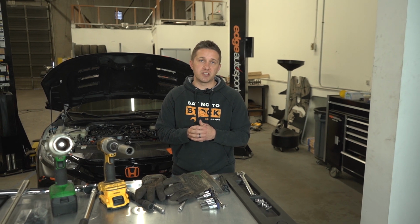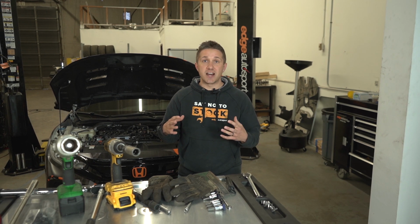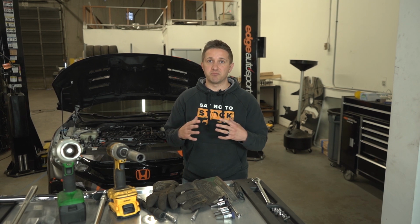So we hopped in the car and we started it, and unfortunately with the twin disc, I think we're going to experience some issues shifting if we don't modify further. What I mean by that is the clutch is not disengaging enough. It's kind of disappointing at this point to be experiencing this, but after some research, what I found is that the slave cylinder and the master cylinder in the clutch system really have a lot of inhibitors as far as making it work perfectly for a performance application.